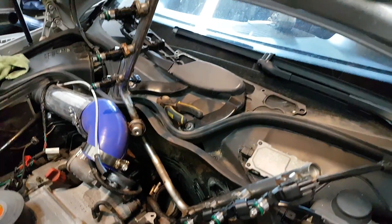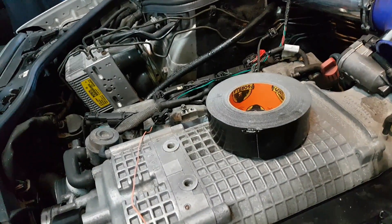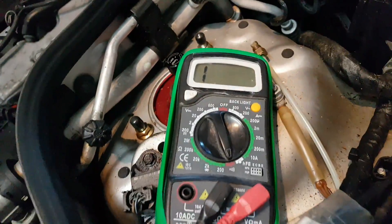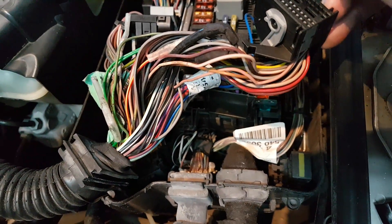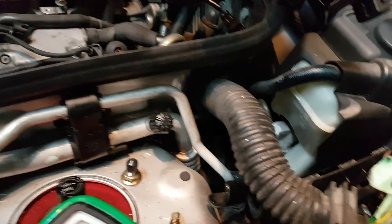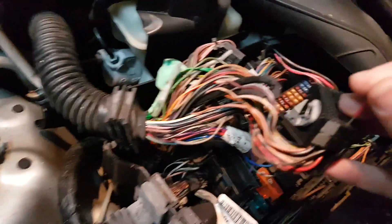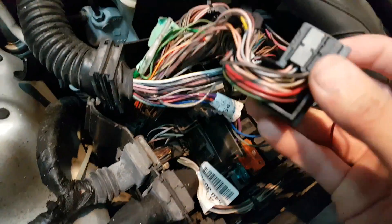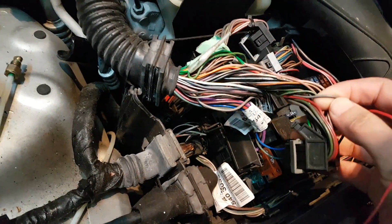I have the injector rail out because I was changing to higher flow injectors, and I thought this was a good time to probe all the wires to check which injector wire goes where. I have a wire connected to one of the terminals of the injector plug and it's connected to my multimeter continuity tester. I just go through each pin one by one and on one of these pins it should beep. I already found the pin for that one — it was this pin in the corner. So I know that this pin is connected to that injector and I can trace the wire from here. For the ones that are harder to get to, you can actually disassemble the plug — it comes out — and then you can see the color of which wire goes where.